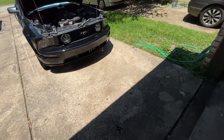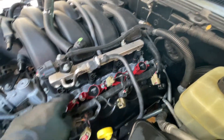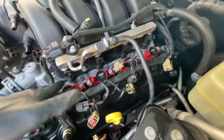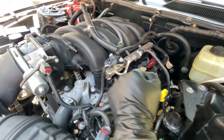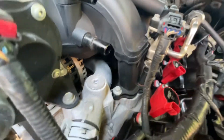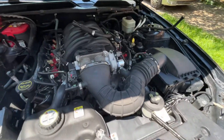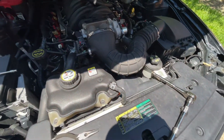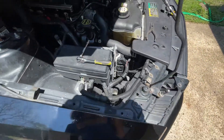It's pretty simple to tear apart and won't take a whole lot of time. I was thinking maybe I was getting a bad knock because the deposits fouled up my spark plugs, so I did this entire bank. Then a wild hair told me to just go look up underneath the intake and see if the knock sensors are bad — and lo and behold, it's torn. I'm trying to figure out how that happened. Maybe a rat got under there and chewed through it, but I'm always driving this car.